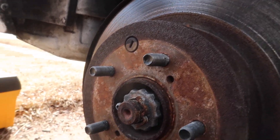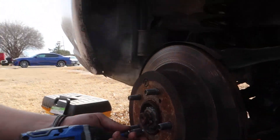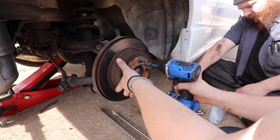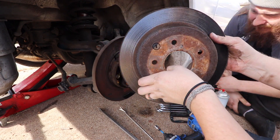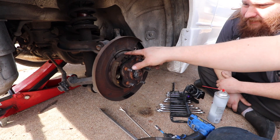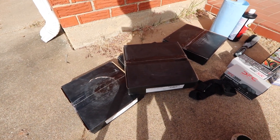You've got holes in your brake rotor — find screws with the same thread pitch and it makes it much easier to come off. First rotor off — it's all crusty and disgusting. Make sure your e-brake is disengaged, otherwise you can't take it off. I forgot about that, but now I can open up the box and show you what they look like.